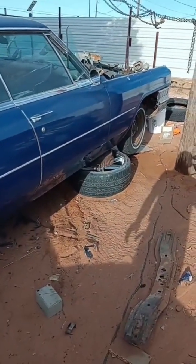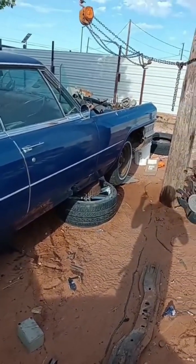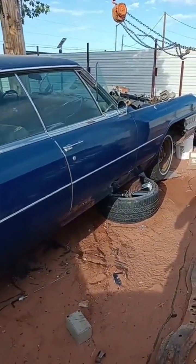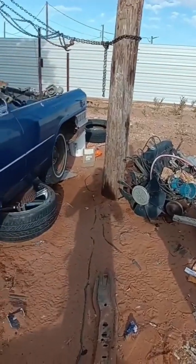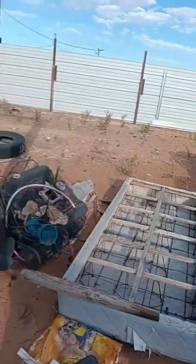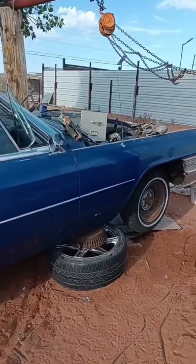So, when I first turned the motor over, it had the starter it came with. And it was making a bunch of racket. And I thought, the Bendix is broken or whatever. So I swapped it out and put another starter motor that I had laying around. And I turned it over a couple of times, just to test that it was good, like the wiring. So I thought it was golden.